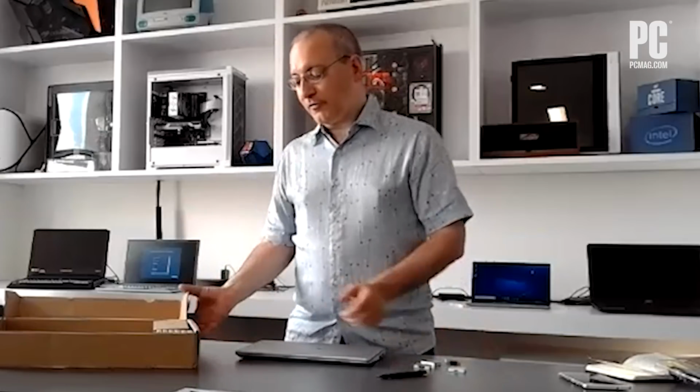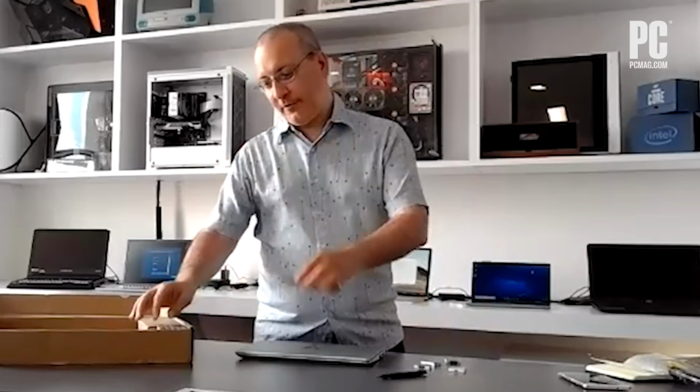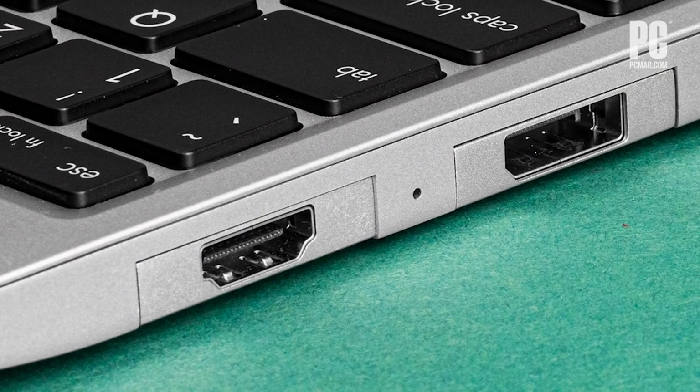We had those installed there just sort of arbitrarily, but you'll notice that in the box here, Framework Computer also includes a couple of other modules, and there are also a few others that aren't included here that you can get. For instance, you can also install additional storage in these bays here. So basically you're installing the equivalent of an external SSD in one of the bays, and those come in 250 gig and 1 terabyte sizes. So in the boxes here, we've pre-removed some of them. We have the micro SD module, we have the DisplayPort module, we have the HDMI, we have 2 USB-Cs.